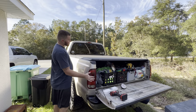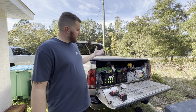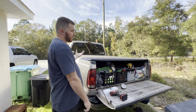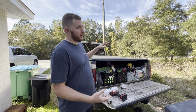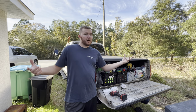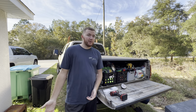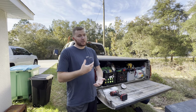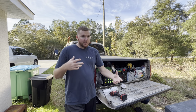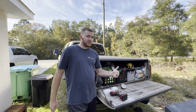Let me show you guys that the third brake light isn't working. As you can see, these light up but that one does not light up when I hit the brakes. For whatever reason, Ford has some weird wiring where the third brake light controls when the torque converter locks and unlocks. The torque converter should lock up halfway through third gear and stay locked into overdrive. The issue is it's not locking in third, or it's unlocking going into overdrive and relocking, making it feel like a slip — but I have no RPM change.